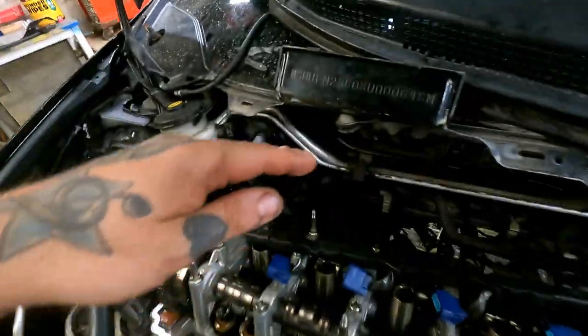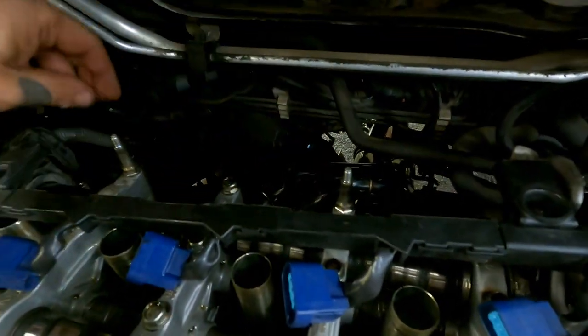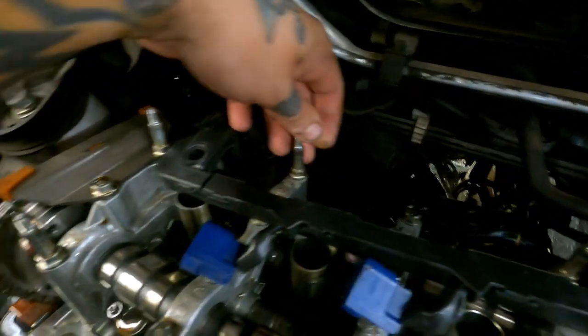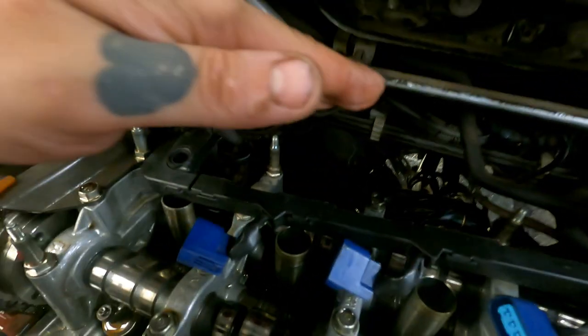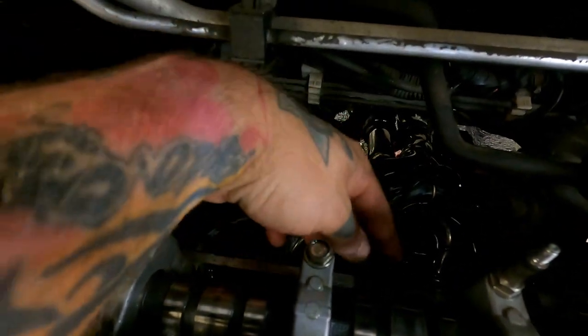We'll see. Right, update. We're in and it worked. So taking off the rocker cover enabled us to get it down and over. The only thing we did have to take off was these really long threaded bolts there, which hold in the camshaft clamp thingies that go into the block. We had to take those two off just to get enough clearance to get down there. And as you can see, she is on. She's not bolted up yet. We've got the gasket on. We've got two bolts in there. There's five altogether. We've got two in at the moment just to hold it in place.